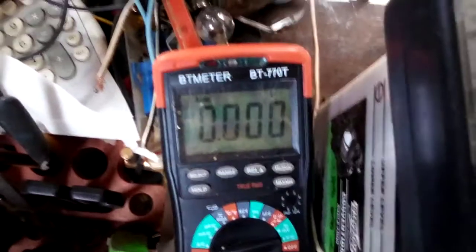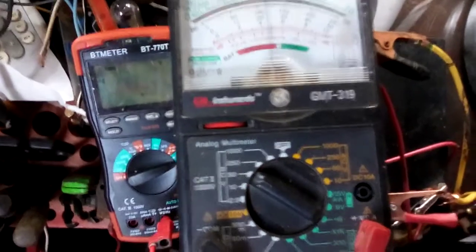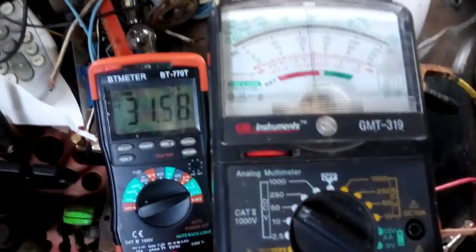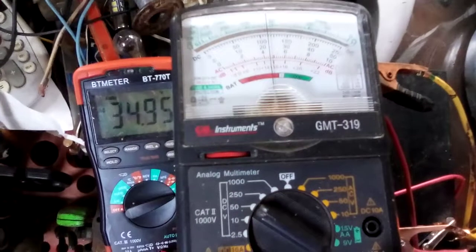There's your AC voltage on the plug. I'll quit talking and show you what I got going here. Just to show you guys, you can charge a 24-volt system — or boost a 24-volt system — with a 12-volt charger. I'm gonna start it up and get it idling. There's your light bulb. We're idling at 31 volts — now watch that battery.